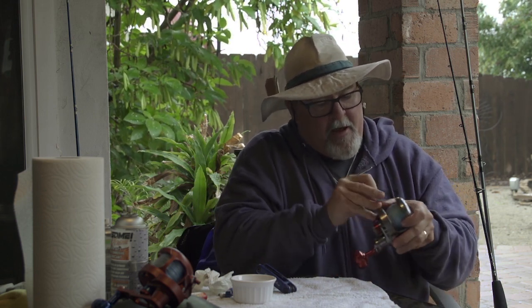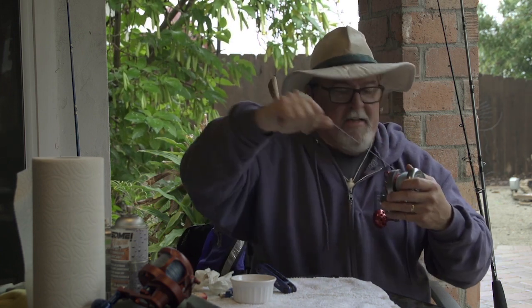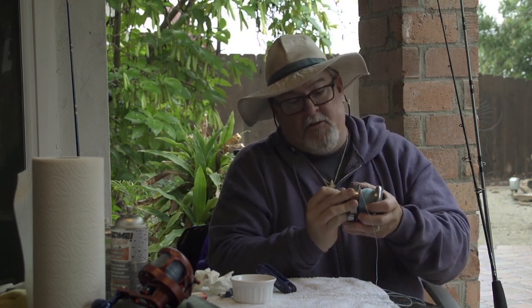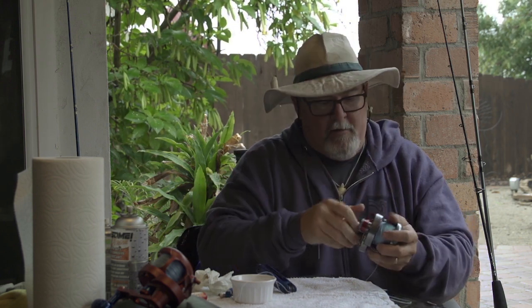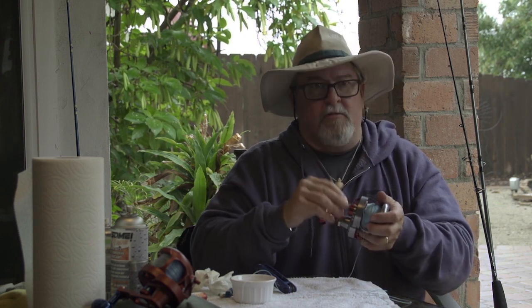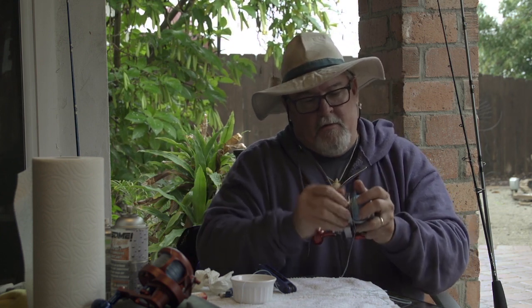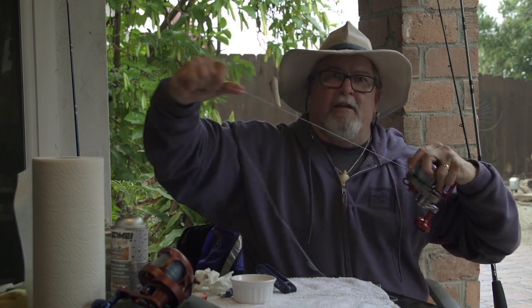So when you're adjusting that drag again, move it up into position, test it. You can see hardly any drag. Take it out of gear, adjust it. That's way too tight. And you'll feel it. If you go to move the lever forward and it's just really snug, never force it, because that'll flatten out the cam and then your drags get really borked. So there we go. That's probably pretty tight. Ah, that's nice. Nice smooth drag there.